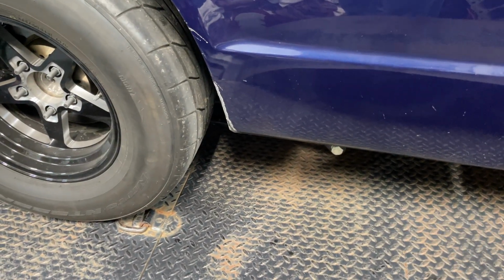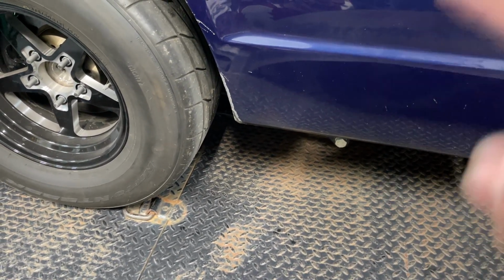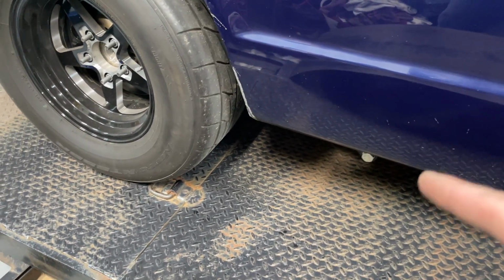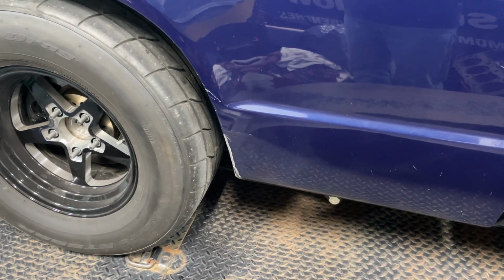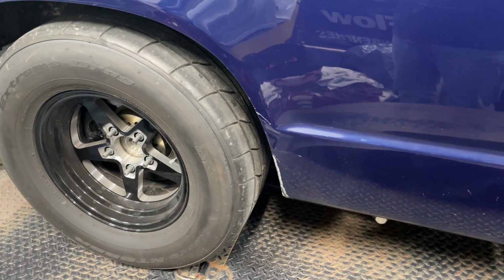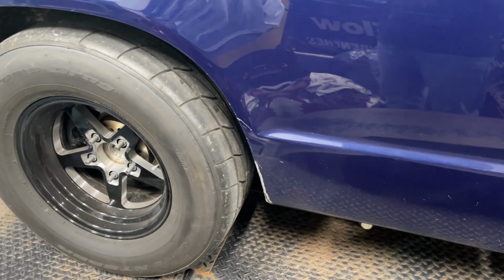And the Caltracs, they're exactly the same, except for what I may do is, because I was playing with weights, I may do a turn or two on this side and that side to kind of get the weights right. But usually it's this side, the passenger side, that I'm going to try to turn if it does weird stuff. Because I did put it on the scales and weigh it and mess with different things, because of the coilovers on front, trying to move weights around to see where to be. And anyway, the truck with me in it weighs exactly 3,200 pounds. It was 3,200 even, which was shocking. I expected a little less, but no, it's 3,200 pounds, and it's got a full tank of gas.